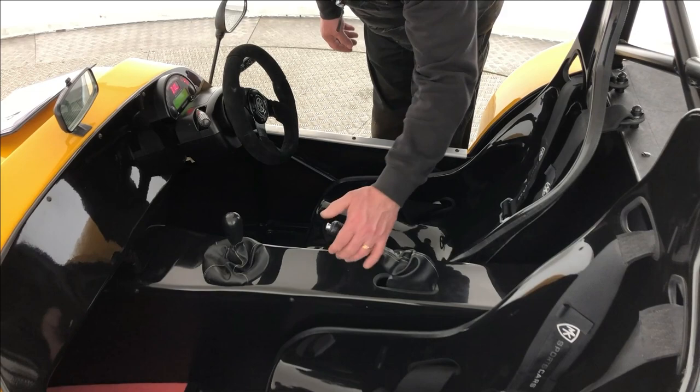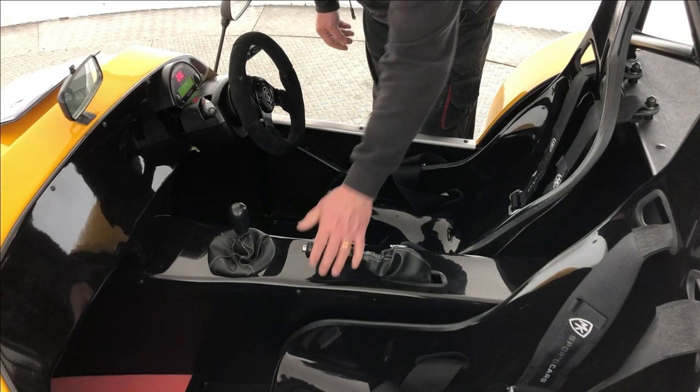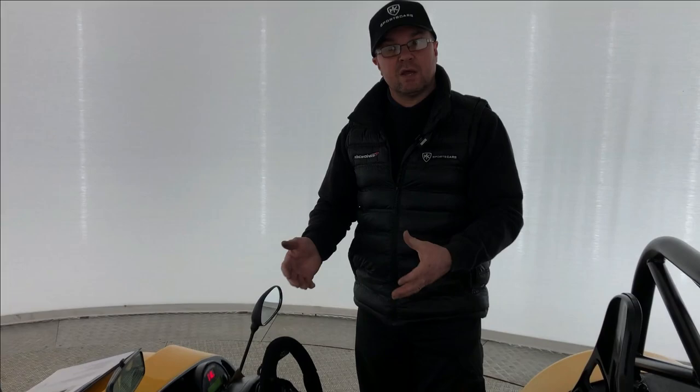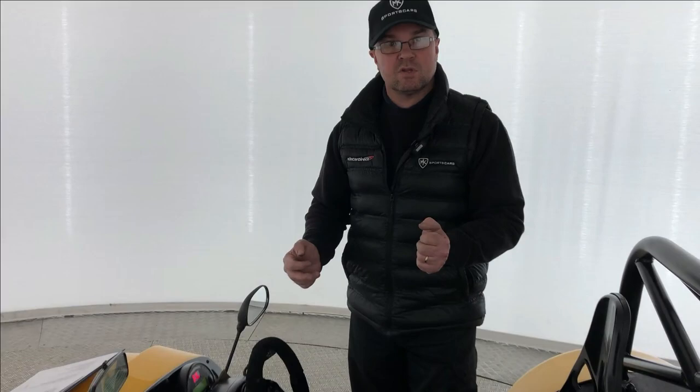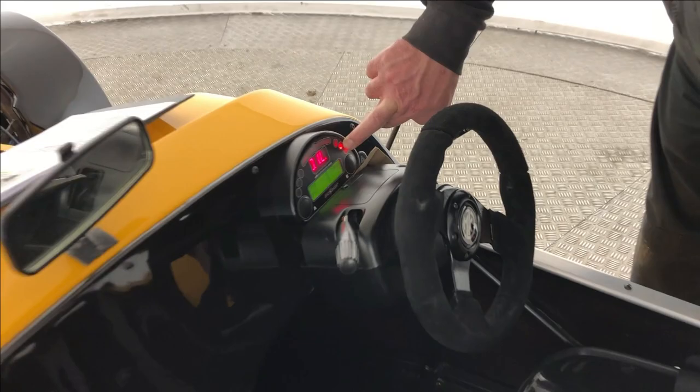While we're here, the handbrake efficiency needs to be tested. Make sure there's plenty of handbrake — if you're going up three to five clicks, make sure there's some adjustment remaining after that. You may need to bed the brakes in a little bit prior to the test, as everything's brand new. Sometimes they'll allow you a little adjustment on the day if time permits. Also, we have ours wired so that a warning light tells you the handbrake is on, shown on the dashboard.